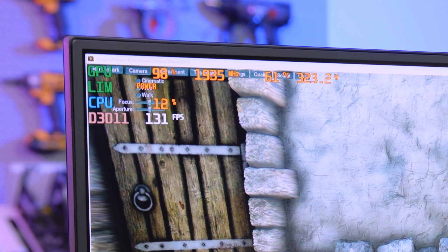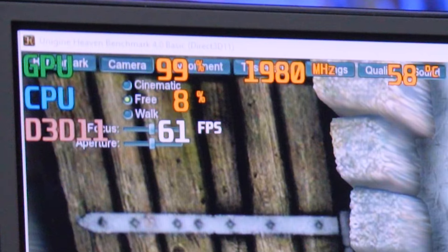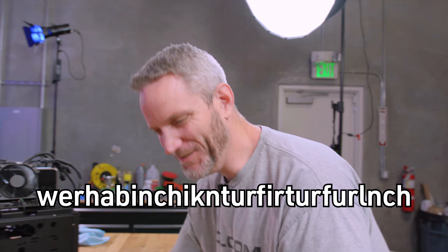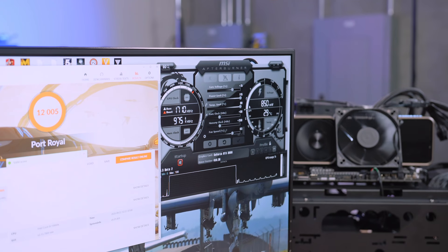At plus 750, look at that dip — all the way down to 132 FPS, only coming back to 140. We've actually got about a 5 FPS loss because although the memory is running fast, it's making errors along the way. This is where you'd normally start seeing weird flickering and shapes. At plus 800, look at that initial hit and where FPS settles — the higher we go with memory, the more impact we're taking. Normally without measuring FPS you'd think you're winning, but you're actually hurting yourself. In Port Royal our score was 12,005 — way lower — and I had to drop the core clock too.